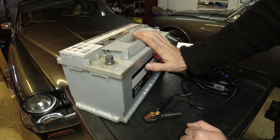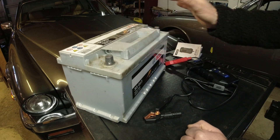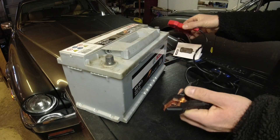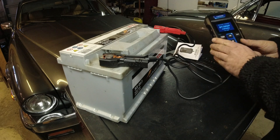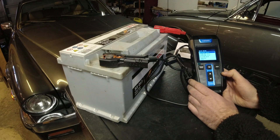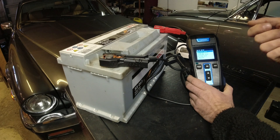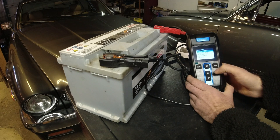So I changed the plan. I grabbed this battery instead because the other one — the owner has removed the stickers, which some people like to do when you put a modern battery in a classic car. But that means I can't really test it because I don't know how powerful the battery is — you've got to be able to read that on the tag. But let's connect this thing up. The clamps are very, very nice, and we're greeted with a display. You have several tests: a battery test, a cranking test, and a charging test. We'll do a battery test.